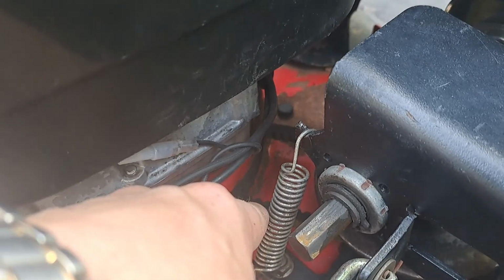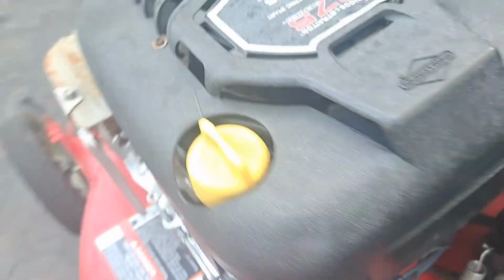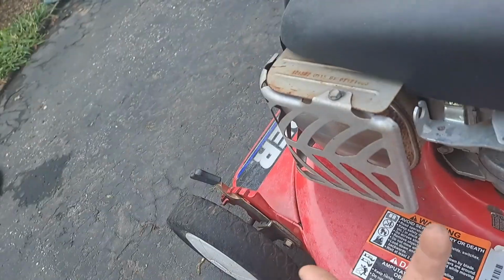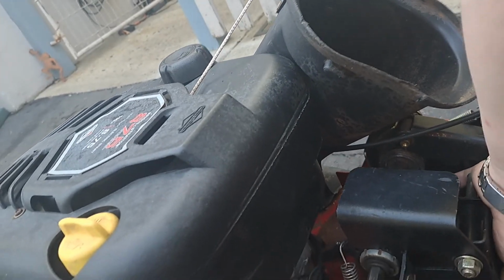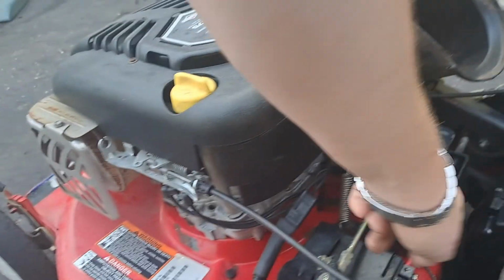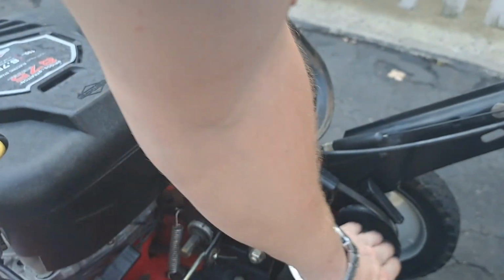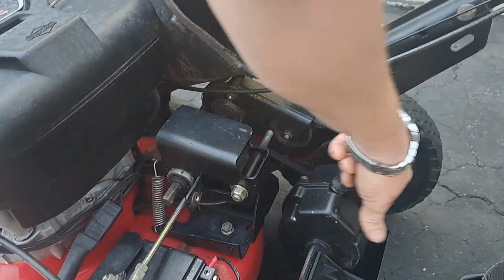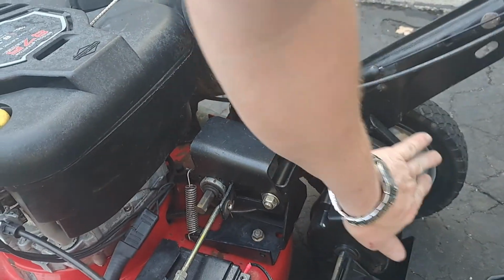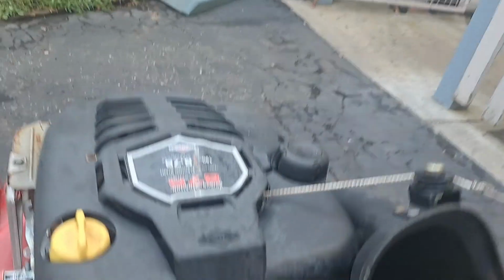And then there's another belt. There's this belt, a cog. See how it's got notches in it, so it's cogged. That one goes from the pulley under the motor to under this plate. This plate turns. That turns this wheel. This wheel turns this belt, and that makes the transmission go. When this is moving, that's moving. See, it's in gear. See, it's turning it. That's how it works.